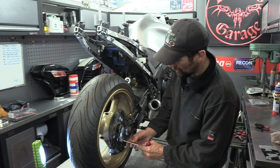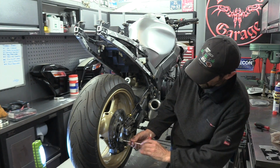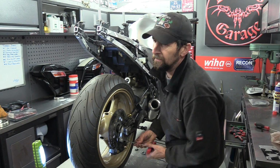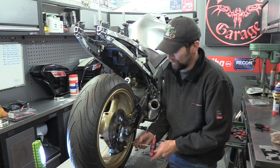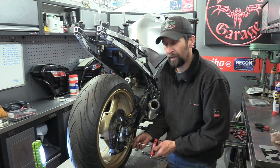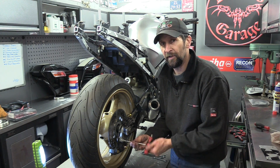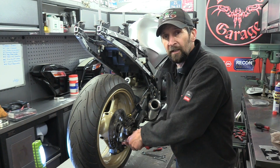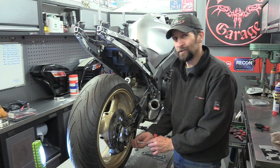So here's what I do once I've bled it through like I have now to get an absolutely clear system. There are little tiny micro bubbles in it and you can just about see them with the naked eye, but they're there, and as I said, they will gang up in the future and they'll add up to a bubble, and that bubble will make spongy brake. And there's no need for that. You've paid for a braided hose and you should be able to achieve a rock hard solid brake pedal every single time. If there's no air in it whatsoever, it won't have any sponginess. If there's sponginess, there's air in it. Can it change the laws of physics, Jim?